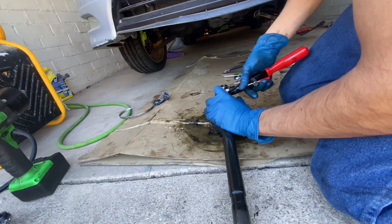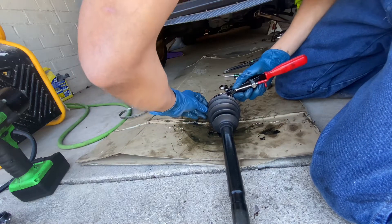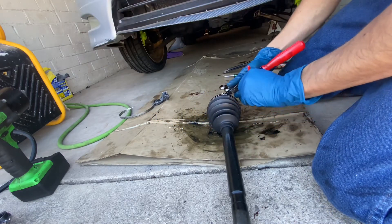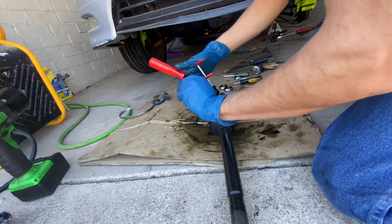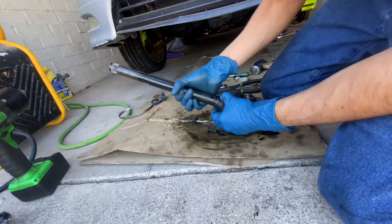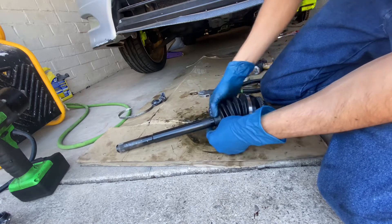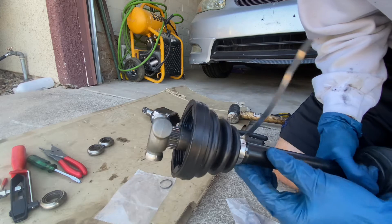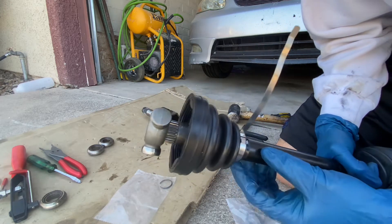There's already some in there, so don't worry about getting all of it inside. Got most of it in — go ahead and proceed getting the boot back on, flush it in. You can feel where it hits so it basically wraps the joint. Grab your clamp that was provided in the kit, grab your special tool, start bending it, getting it nice and tight, and make sure everything is flushed. On the other side, there's a notch as a stopping point which will guide you where to put the boot. Don't forget to put in your clamp first before putting in your boot.